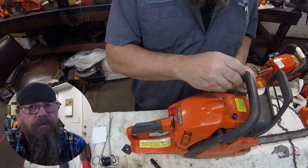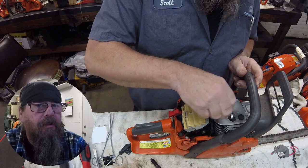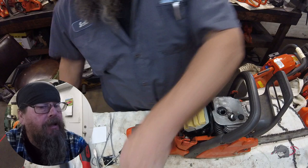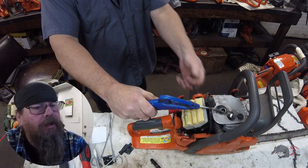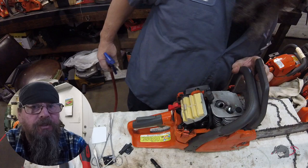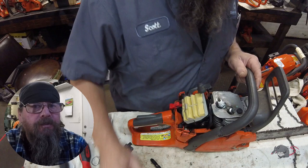So what's the problem? Well, if you were following along, you may have noticed that I had a pretty flooded saw. And I had it upside down and I was pulling on the cord, and I never actually cleared that condition before I rebuilt the carb and put it back together. So here I'm just going to blow the excess fuel out and then we'll retry it again. That one was on me for not clearing the flooded condition before I started — I threw it on choke and pulled it 10 times and it just flooded it worse. So let's put this back together and see if she'll run. And it will.